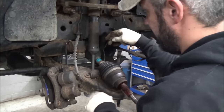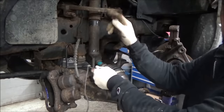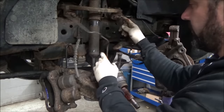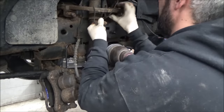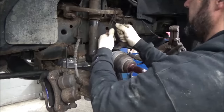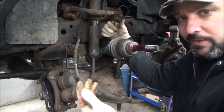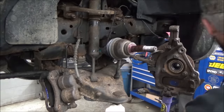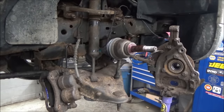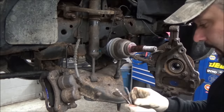What we'll do is take and throw a little wire tie on this little guy, because before we throw this upper ball joint in, we need to address the caster adjustment. The caster adjustment is right there on the end — this has an adjustable upper control arm so you can adjust the caster with just the control arm or just the lower part of the ball joint. Looks like we've got a snap ring on there, so we'll take that off — get some pliers. We'll get this snap ring off.